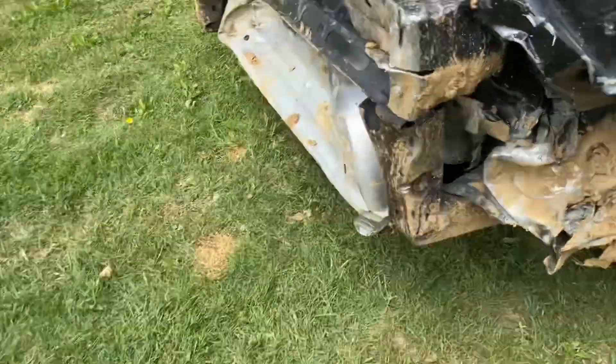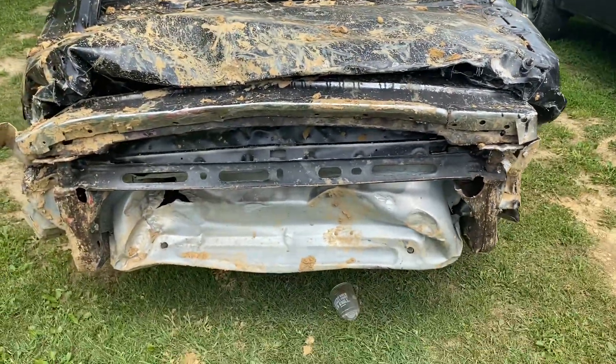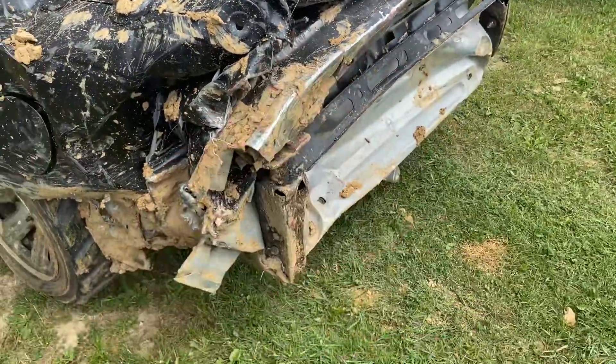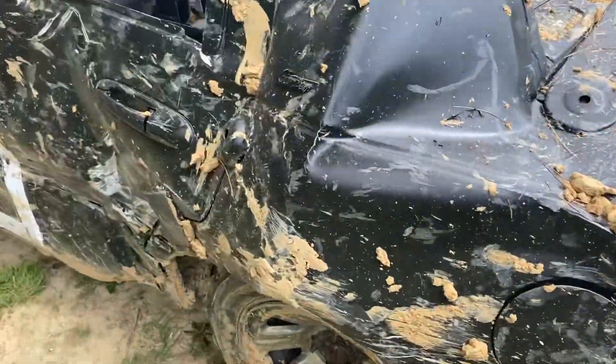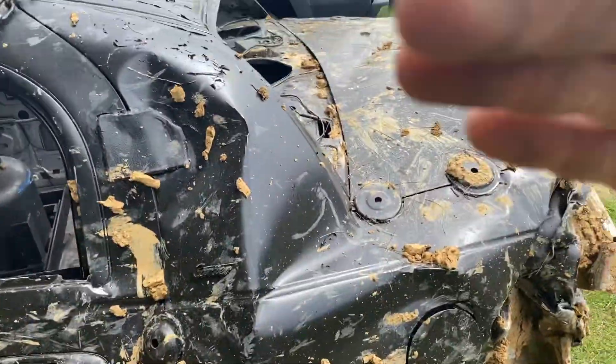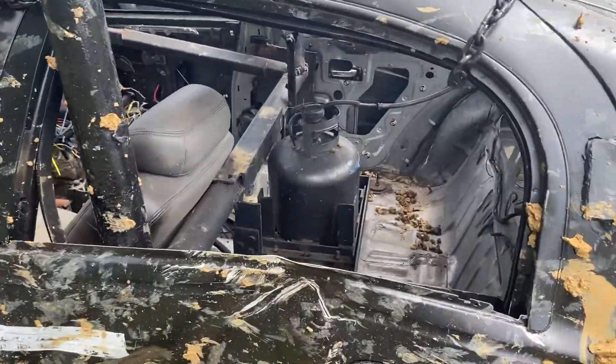Now that it's been in, both sides bent up perfect. I think what I'm gonna do is pull that bumper back a little bit, dish it down real nice, take some stress off these quarters, and dish it down as much as I can with the speaker deck — and probably put a window bar in it.